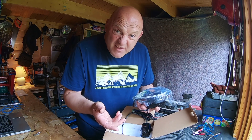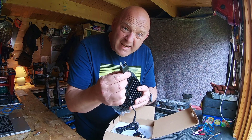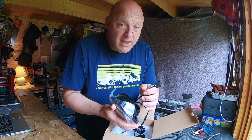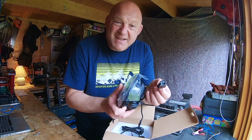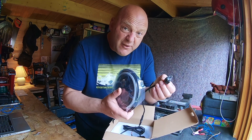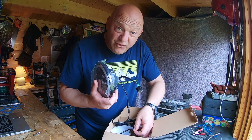Let's just see if we can get this to work. So you've got your headlight, and then this is just your normal connector which you would connect your headlight into in its housing. It's basically going to have a negative feed or neutral, and then a live feed for your low beam and a live feed for your main beam as well. So we're going to test that out and see what it's like.